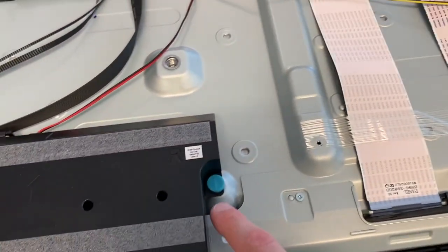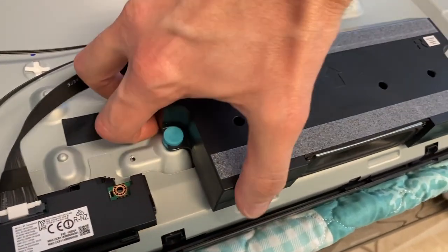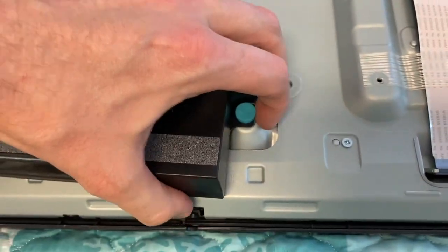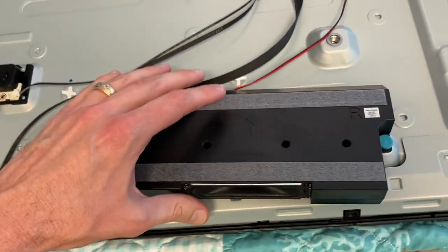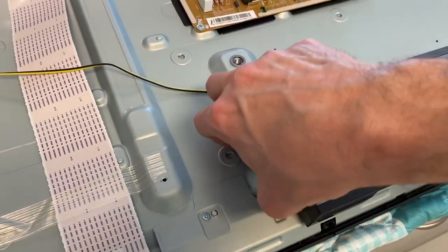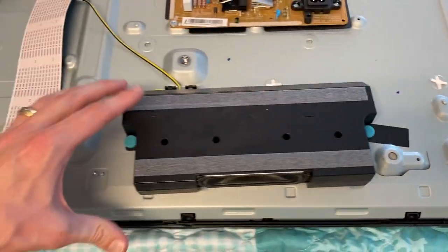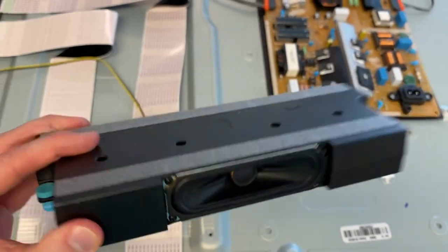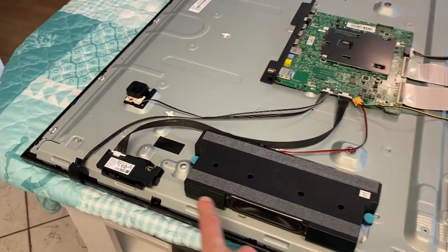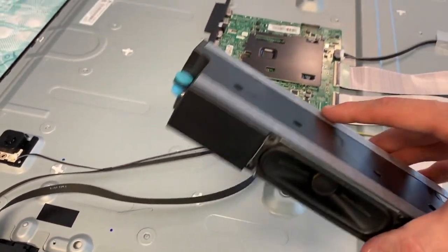You've got little rubber grommets that secure your speakers in place. Carefully pull up on the speaker until those rubber grommets come out of the slots. I'll do that for both sides. Chances are both of your speakers are not damaged; however, when you purchase one speaker you're getting them both, which is pretty neat. We'll go ahead and pull this one up and out — just be careful as you do this. On the top portion of the speaker closest to your Wi-Fi module, you've got the electrical wiring that feeds into that slot. Just carefully shift that outward so you can get this speaker up and out of there.